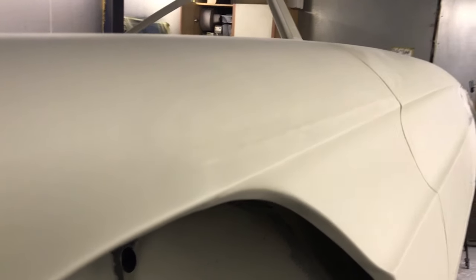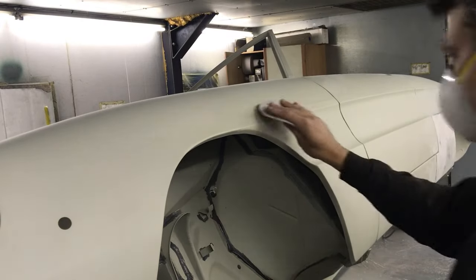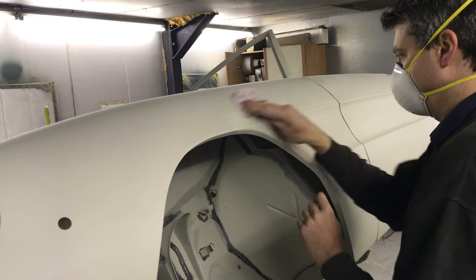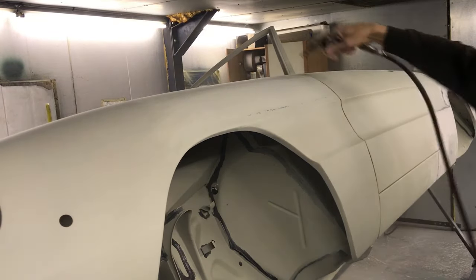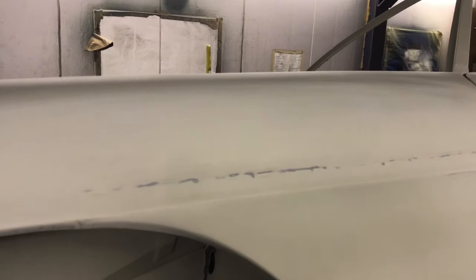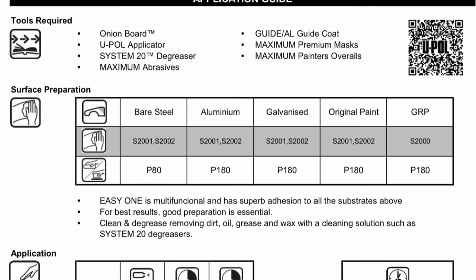This is the part I want to fill — it's a panel I welded in and there's a butt-welded joint. Before applying the filler the epoxy needs to be sanded with 180 grit paper. The datasheet advises this if applying over paint, and 80 grit if applying over bare steel. We can see the high spots as the paint was taken off, but this isn't a problem.